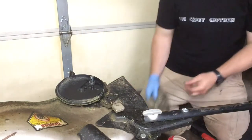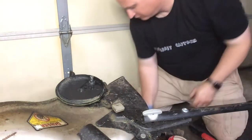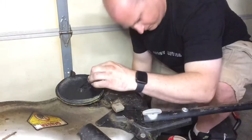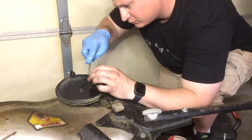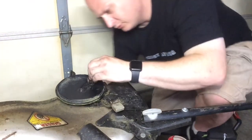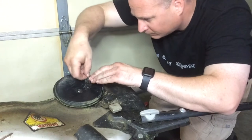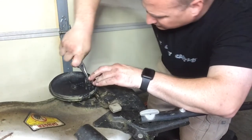When you put the cover on, make sure it aligns with the hole where the bolt goes — there are two holes, one goes around the shaft and the other gets secured in. Put the key in, then get the gear and turn it until it falls into place. Put your washer on and then here we go again with that stubborn locking washer. There might be a special tool for these — I've always just used a screwdriver. Some are harder than others; just put it in the groove and work it with the screwdriver. This one gave me a little trouble. Someone can put in the comments if there's a special tool for these locking washers.